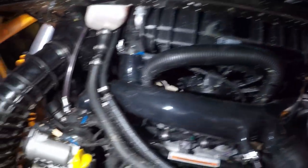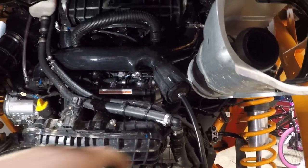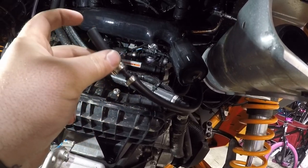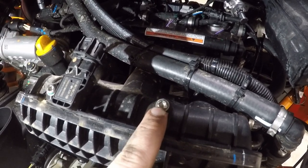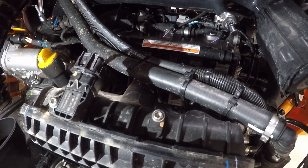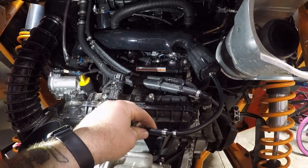Charge tubes are all installed — up to the intercooler, down to the throttle body, new clamps installed, and the blow-off valve was put onto the tube prior to installing it. Now we need to hook up the blow-off valve. The long hose from the kit is already on it — the smaller end goes onto the BOV, and the larger end goes into an adapter fitting into the intake manifold. There's a factory plug there with a 30-Torx that we remove, transfer the O-ring to the new barbed hardware piece, clamp it down, and that's how the BOV gets its vacuum signal.